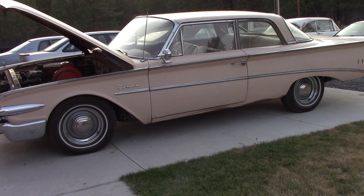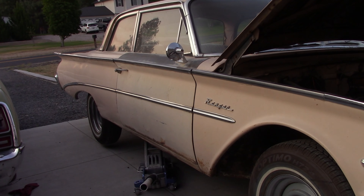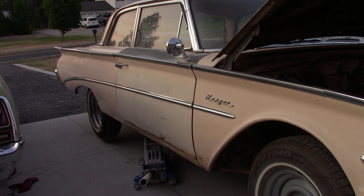The wheels I've chosen are probably not really the right wheel for this car, but I had them available and haven't put them on another car yet, so we're going to try them on this one if they'll even fit. The main issue with fitment is going to be the rear — whether these wheels and tires will actually physically clear in the wheel wells. I've run a lot of 15x8s on other Fords with up to a 275-60-15 and been able to mostly clear, maybe some rubbing with people in the back or going around a corner.